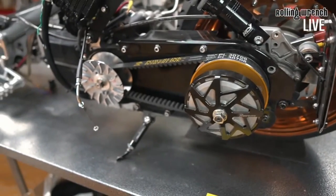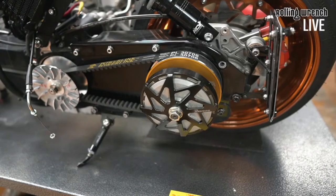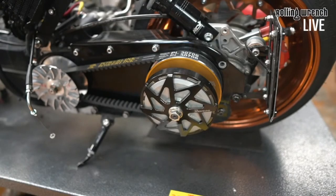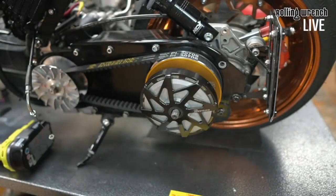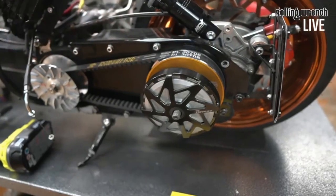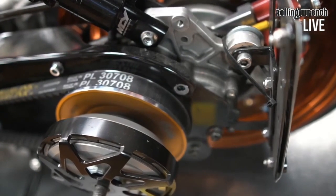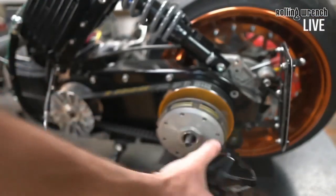Here's the Ravino clutch that I have on the 232 Ruckus. You'll notice I have an aluminum pulley back there — I really want to test it because this is an aluminum pulley and then we're going to test an NCY pulley to see the difference, since the goal is to go lighter. Little trick of the trade: notice this pulley on the belt — see how flush it is to the end of the pulley? That's what you want. That's an 842 2030 belt.